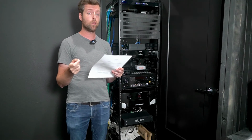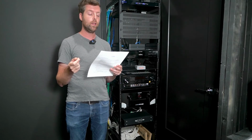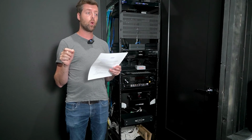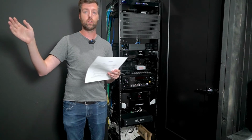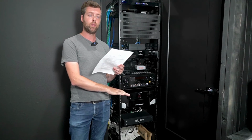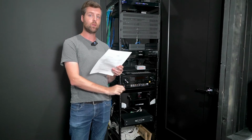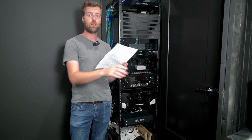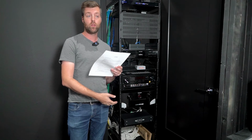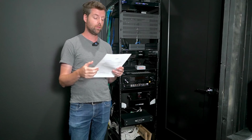You can actually parallel speakers to a single zone if you want to, as long as the impedance remains at 2 ohms or above. And this is more commonly done with outdoor speakers, patio speakers, or in really large rooms where you've got a whole bunch of speakers in a row. In my setup, I haven't done that, but I do plan to add a patio sound system that uses these little pendant-like speakers that go around the pool area. I still don't plan to do that because I have enough extra zones here that I want the extra amplification, but it is an option.